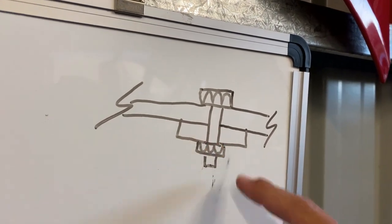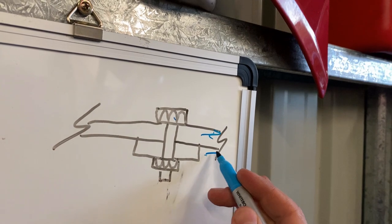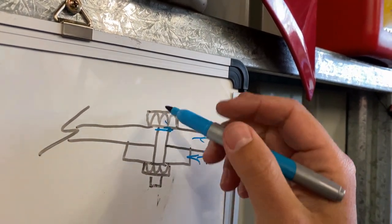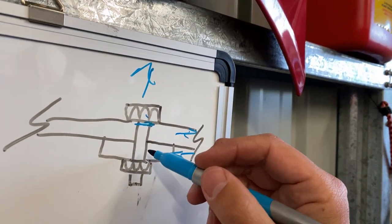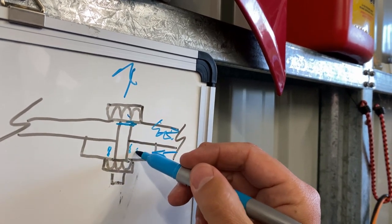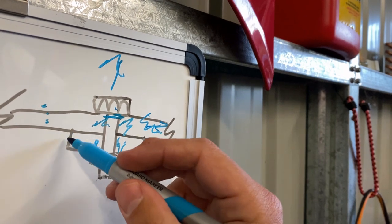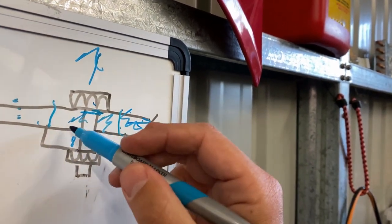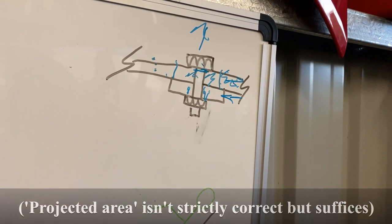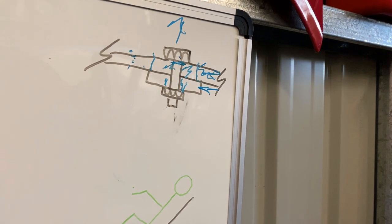In Australia we require a 75x50mm plate, whereas these are only 50x50mm — so check with your local regulations. It's important to do these things now, because if you ever want to race in a particular class you need to be aware of the requirements. The seat mounting points — I've just used a washer for now but I will be putting in a larger washer to increase the surface area. To explain how it operates: for shear load, the effective area resisting movement is the bolt diameter. For tear-out, if you're just using a nut and bolt, the area resisting pull-through is only the projected area of the nut, which is very small in thin sheet metal. The reinforcement plate increases the effective area resisting that pull-through.